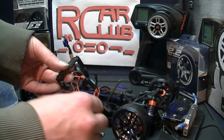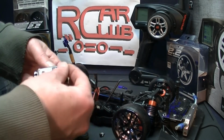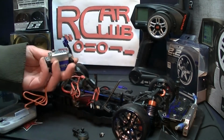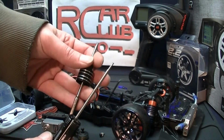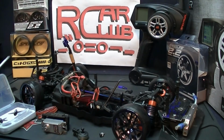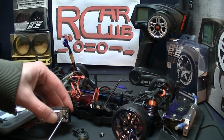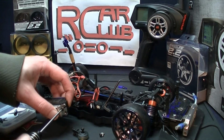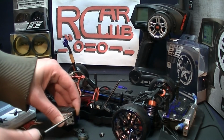So what we want to do, I always put my screws back in there just to store them. Makes your life slightly easier when you come to reassemble it and you don't know where the screws are. And then literally just get my screwdriver. So I find these quite handy. I've got swappable bits in them. Take that one out there, put that one back in there, and you're good to go again. The right size. Always make sure you've got these located in, and sometimes what you'll find is if you go backwards till you feel it click, it will drop back into the original hole, and then you're not obviously stripping out anything, but get that on in quick.